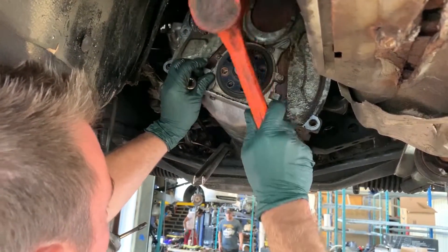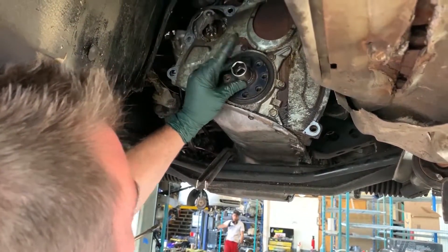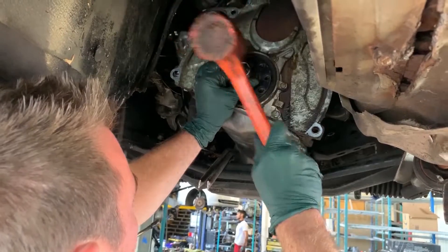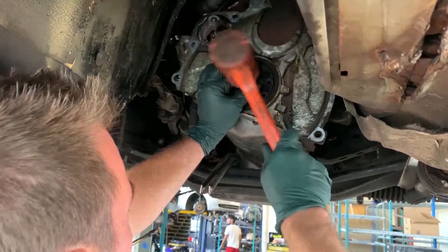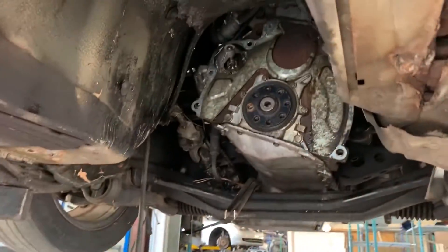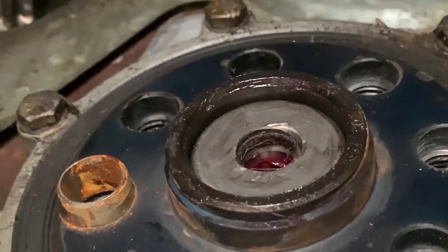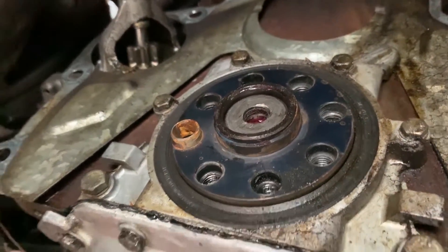The E30 bearings — the real OG ones — have this outer cover on them, so you don't really have to be too careful. Because the outer cover only contacts that bearing surface I told you about. So that right there is a properly installed, albeit used, pilot bearing. You can see that it's recessed from the outer lip about an eighth of an inch, possibly even up to a quarter, but that is fully seated, and that's what you want it to look like.